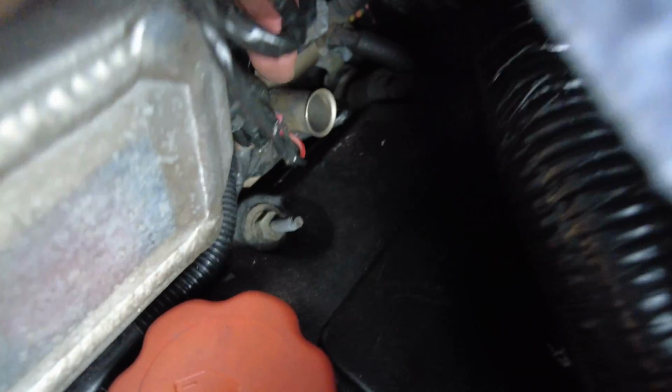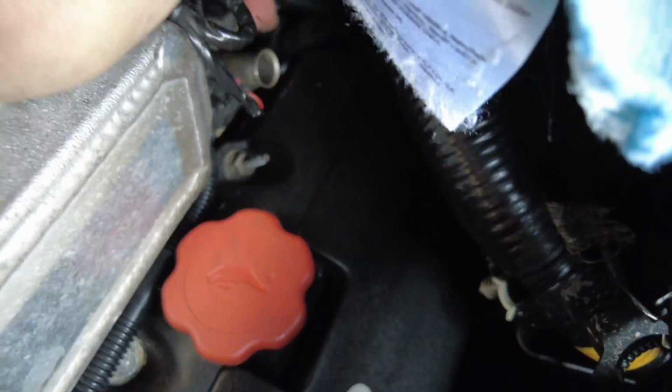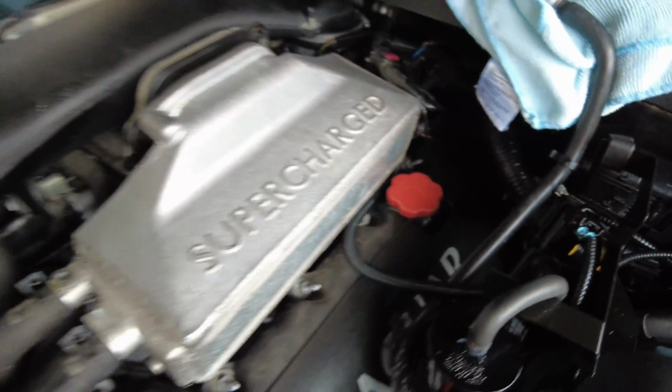The other thing I've been able to do just in here is move that around. I've also been able to release the fuel line. There's a special clip that goes around here, and you push that way, and it frees off the fuel line. You can see the other end here on the rag, just tucked out of the way.